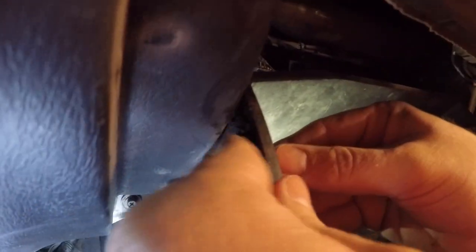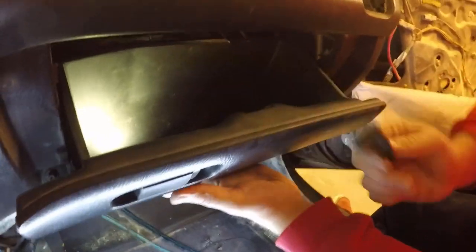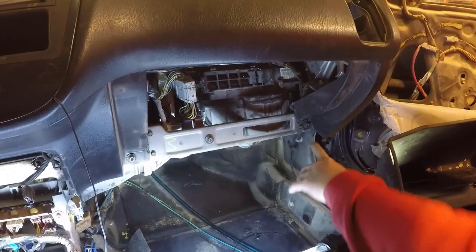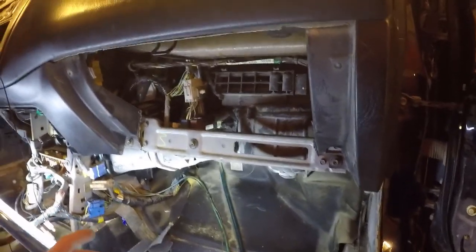On this side you can see these two little plastic pieces. Basically all you have to do is push them in from the back and that comes up — and that's out. Same thing on this side — there we go. Now everything else is exposed, you can see these couple of bolts here that we need to access to get the dash out.